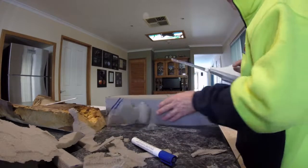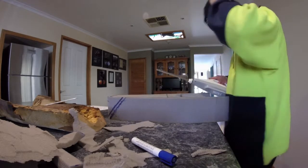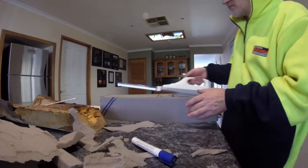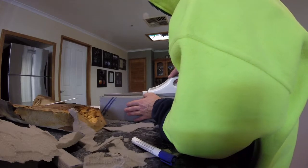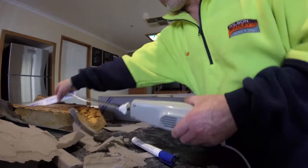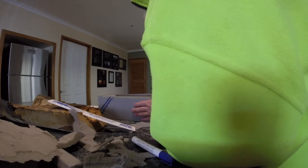Okay, so that's done. So what I actually need to do now is cut out of the centerpiece exactly 15mm out of the guts of it. So I'm going to do it in sections. I think what I'll do is I'll make a wedge cut down the guts. I'm guessing that the blade is probably, what's the blade? The blade's 15mm. So if I use the blade depth as a reference,